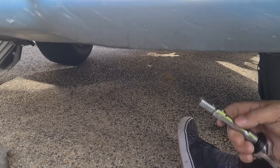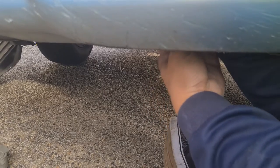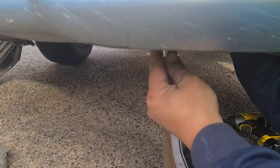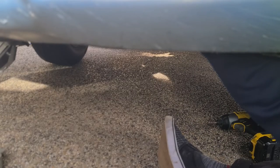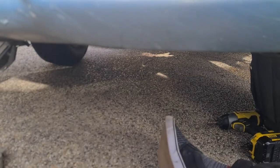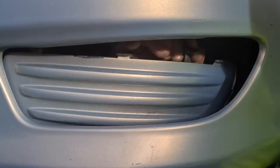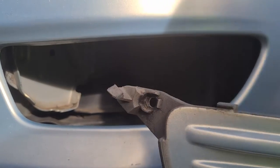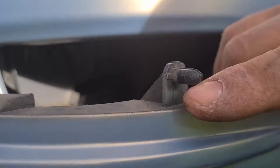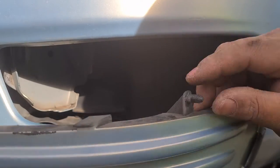For the next one I'll use the ratchet — coming underneath, looking for the top corner where the bolt is. There isn't much room, so be patient: break it loose with a few turns, then use your hands. Once loose, you can see there are two points that clip in at the top, and this part slides in. To remove it, go that way first and then pull out. The cover comes out toward the center of the car, then you wiggle it free.